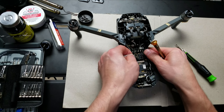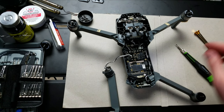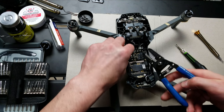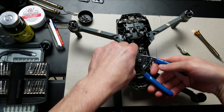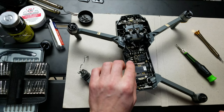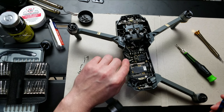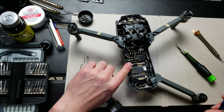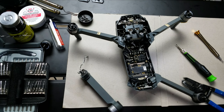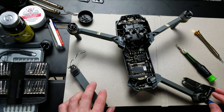Here's where the wire cutters come into play. I'm going to take the wire cutters and cut all three of these wires because they're gone. Something to remember is that these are color-coded. We have gray, white, and black. We're going to have to copy the same color-coding — gray, white, and black — when we put the next set in.